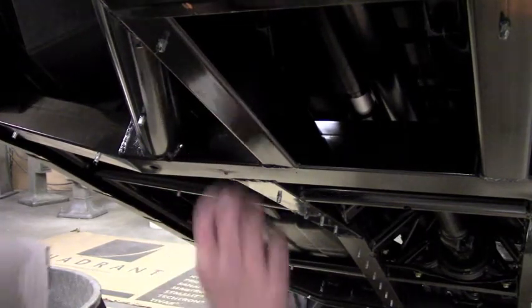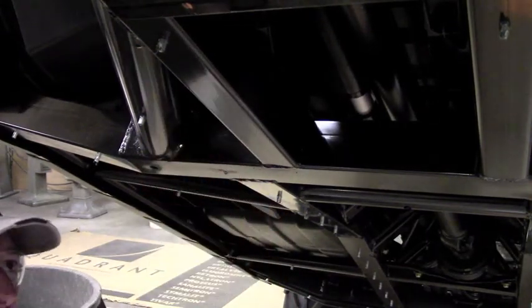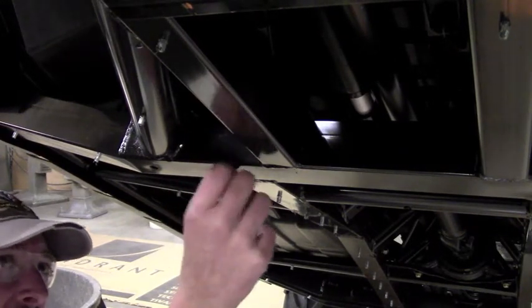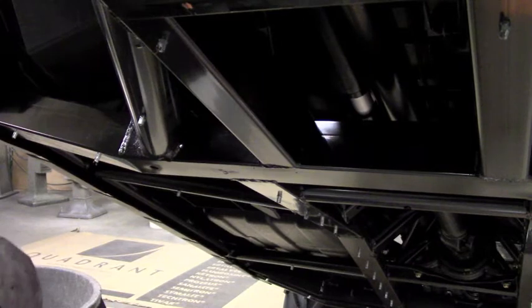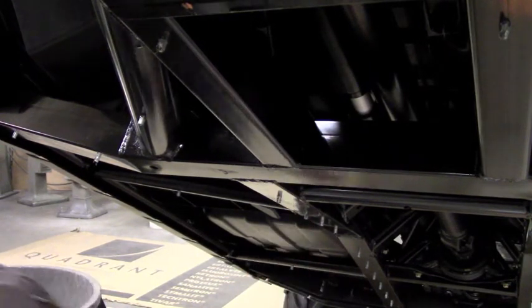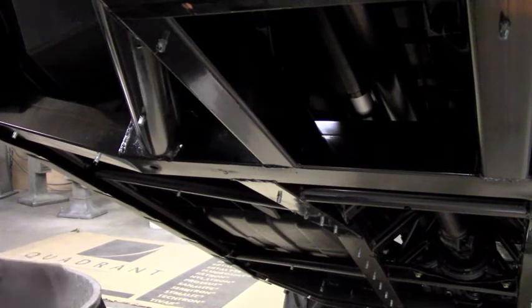You can see that's pretty much taken care of that. So now the skid plate will be able to butt up tight against the frame. It's going to be a little more time-consuming to do it that way, but you won't be knocking all these rivets into the frame — because once you knock them in, they can't get out. There's nowhere for them to go.